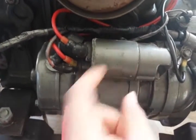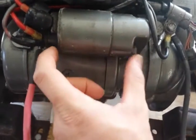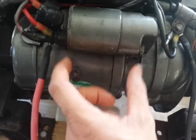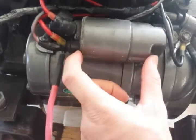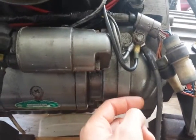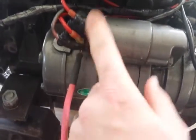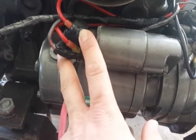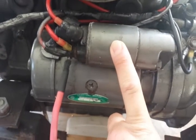That's going to energize the coil. It's going to communicate this power here — it's going to make up inside. This is both a pull-in solenoid and a relay basically. It's going to make up the start circuit here for the starter once it pulls in. So you're really doing two things: it's a switch and it's a solenoid to pull in the throwout gear on the flywheel. What you do to decrease the starting current across these terminals — because if you put a switch here and here, that'll work — but your switch is going to be carrying whatever the pull-in current for the solenoid is.